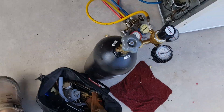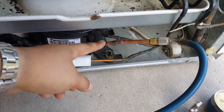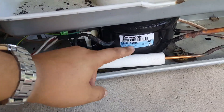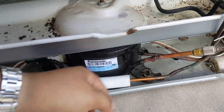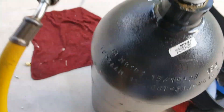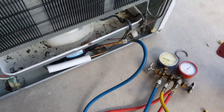Here's my equipment — I installed an access valve here. If you don't have this type of access valve with a cap, don't use piercing valves because those leak. Instead, locate the suction line — that's the low side — and put a T fitting there to add your access port so you can refill with refrigerant. Right now it's at 120 psi. Hopefully I can do this repair and fix the refrigerator — I'll make an update video.